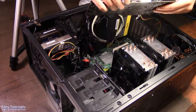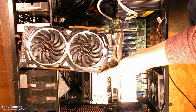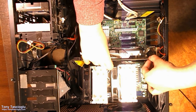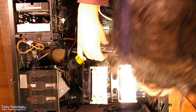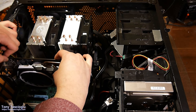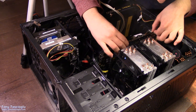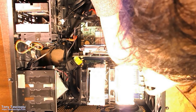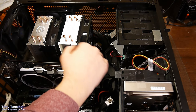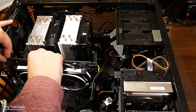Alright, so for the GPU, here's our GPU. I just want to make sure both cameras can see this because that's going to have a battery. You're going to mount it sideways, skip the first slot, the next two down, line it up, and it's open end, so as I said, this card will just slot right in, even though it's an X16 card and an X8 slot, we won't have any trouble.